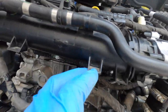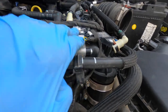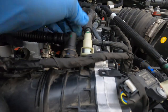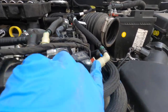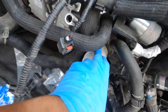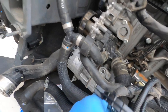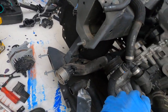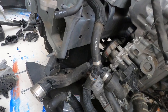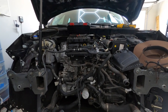Most of the stuff is now installed — hoses are clipped in, the throttle body and everything is clipped in. I broke one clip so that's coming off easy and I'll just have to pull one from the other car. This hose might be bent a little, that's why it's rubbing, so I'm not sure if I should slowly bend it back without breaking it. The next thing I'm gonna do is put the alternator in, put the cover for the alternator on, connect everything up, reroute what I need to reroute, and then the only thing left after that will be the radiators.